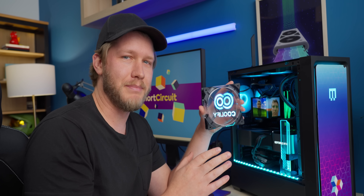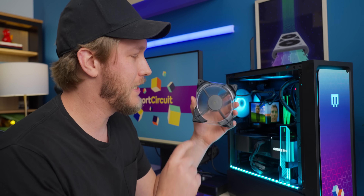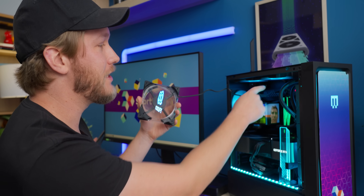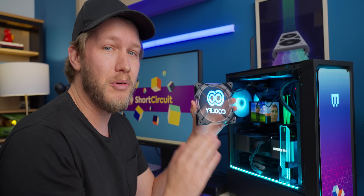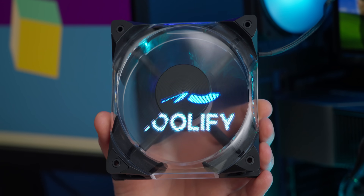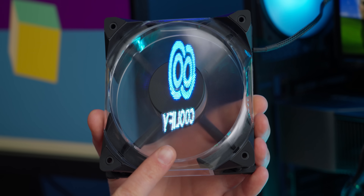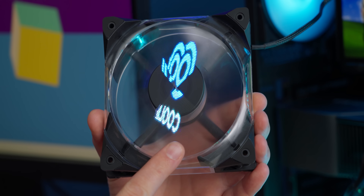Bell said apparently if you give it less power, it will sound better — that is not a thing. This has to spin at 2600 RPM all the time. There are only two leads going to the motherboard, which means you have no control over the speed whatsoever. And there is a good reason for that — see how we have this image? That is based on the RPMs of the fan, so if I start slowing it down, you can see the image just kind of starts to fall apart.